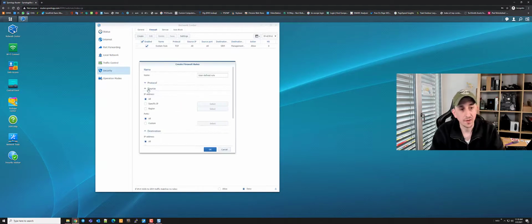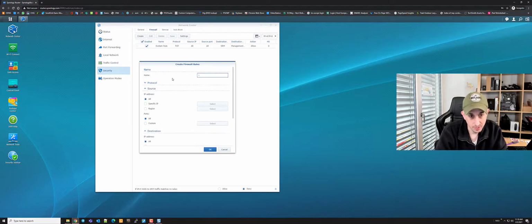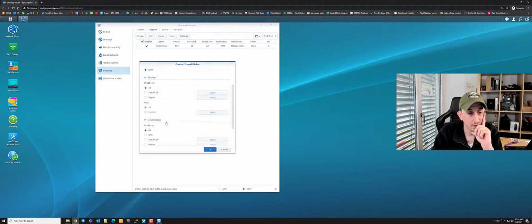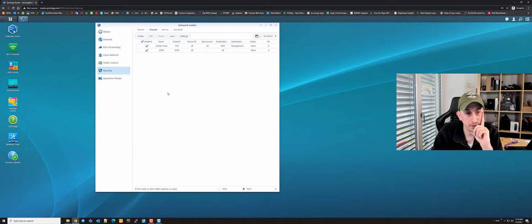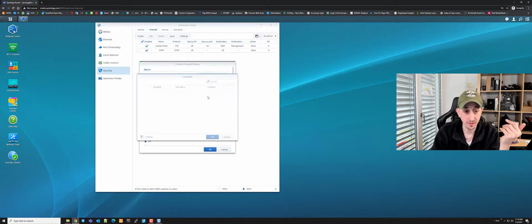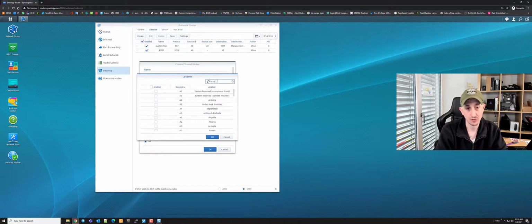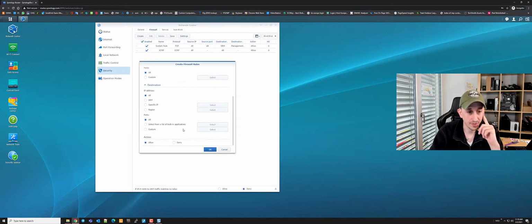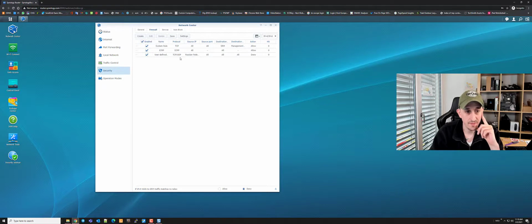Firewall. And this is where I need to put in my ICMP rule. All allow. Okay, cool. So basically here is where you set what you want or do not want. Very, very nice, super easy to use. Don't like Russia, don't want to be hacked by the Russians. Region, select Russia. Job done. Deny everything Russia.